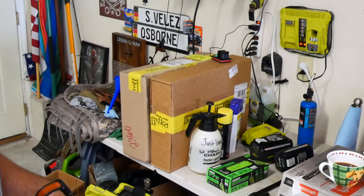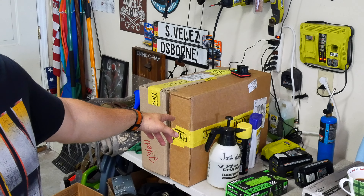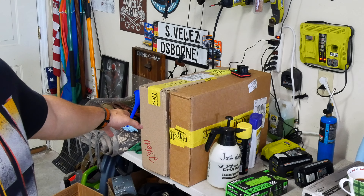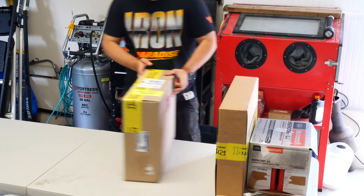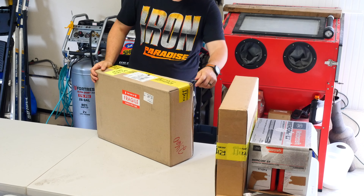The purpose of today's video is going to be a nice upgrade to the truck. What we're going to be doing today is switching out the transmission pan for a 6.4 liter Powerstroke trans pan. Same 5R110 — they just updated the pan from the 6.0 to the 6.4. It'll hold more fluid, they changed the filter design, and it still fits in the valve body of the 5R110 just fine. So let's get to opening these up and see what we got.